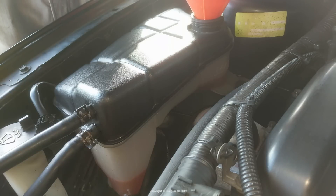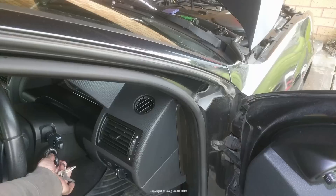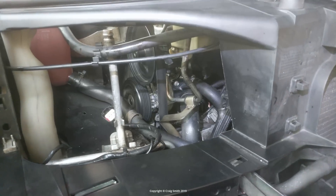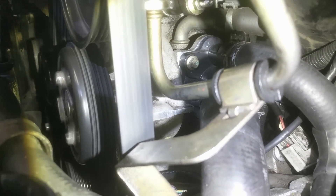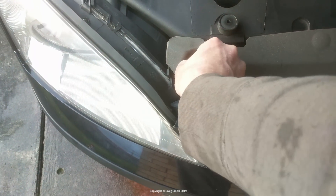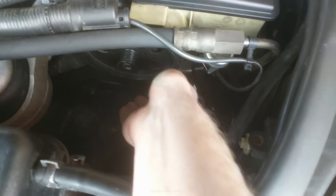So with all that back in place, I poured the saved old coolant back into the tank, then filled it up with pre-mix and started the engine. Watched to see if any leaks developed — and success so far. You'll need to go through the usual process of bleeding the coolant system. The level in the tank will drop a bit over time and you'll need to top it up. The best way to check for leaks is not to look at the level, but to use your hand again — reach under and feel around to see if you can touch any wetness.